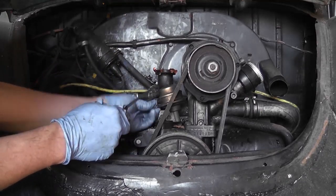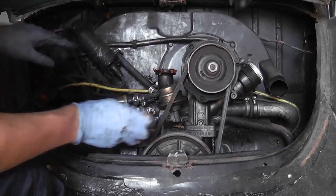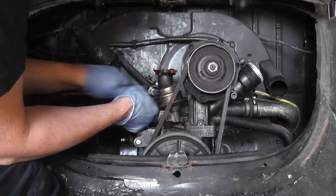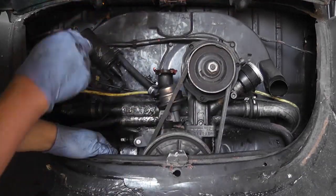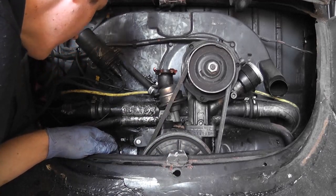One of the things that people put a fuel filter in the engine bay for is ease of access and changing — still thinking that it's the right thing to do. But it's most certainly not the right thing to do, because a fuel filter is a point of failure and you don't want a point of failure in the engine bay where everything is hot. What you do is put the fuel filter up the front of the car — that keeps it away from sources of ignition.